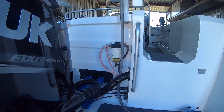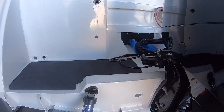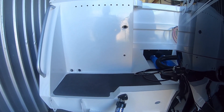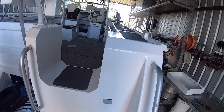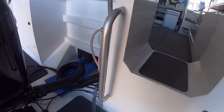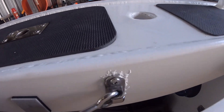All the rest of the paintwork and everything seems to be holding up good. You can see those few little rust marks there — I'm not sure what they do in the factory, but if they're building jigs in the same places they're building these boats, they might be getting a bit of grinding dust over the holes. That's causing that bit of surface rust. If you grind over paint or aluminium, little pieces of mild steel get on there and then rust. There's another one of those little dots on a different floor area, but the paint seems to be good.